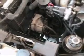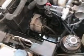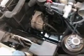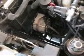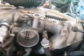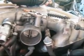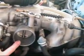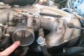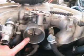Okay, I've gone ahead and pulled out the air box, and it was actually a 10mm bolt, and you probably want to use a closed-in wrench. It's just the easiest way to get that out. And I will go from there. While you're cleaning your air box or changing your mass airflow sensor, or cleaning that too, and you've got the elbow off, it'd probably be a good time to go up in there and clean the butterfly. Just take some carb cleaner and some paper towels or clean rags and clean all that out real good, getting the crud, or carbon, that's built up over time.